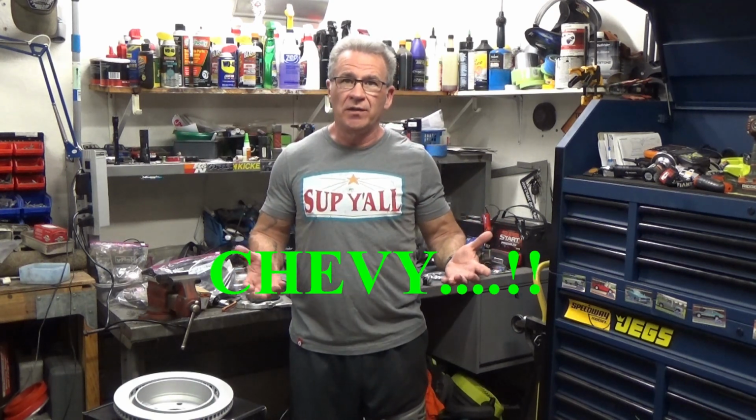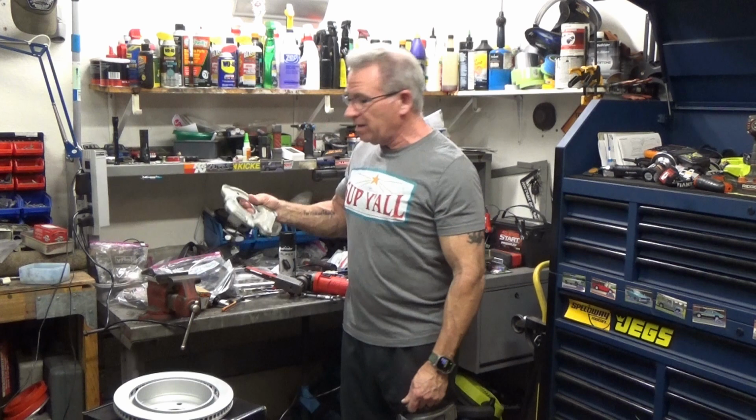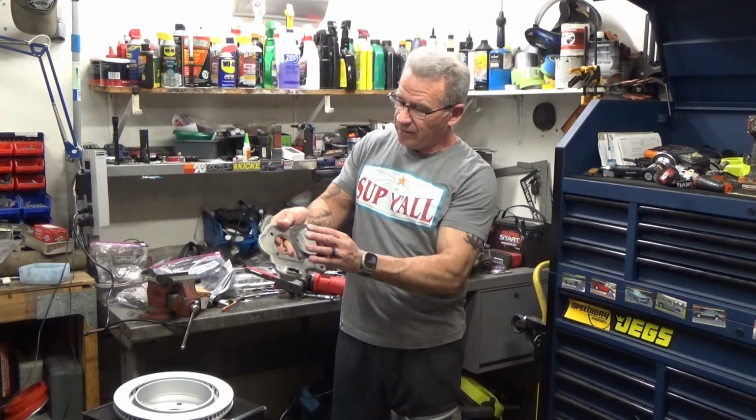Now, stay tuned for the rear brakes, because I kind of forgot something when I started doing this. That's right, I don't have a Chevrolet rear end in this car. On a GM axle, a 10 bolt or 12 bolt, those are all C-clip rear ends, and the only thing you need is this spacer plate, which I will put below if you have a standard GM C-clip rear end. I'll put the link below where I got this. I think it was 40 bucks. Basically, this is the backing plate for the Camaro. It goes onto the axle, it spaces it, boom, you're done.